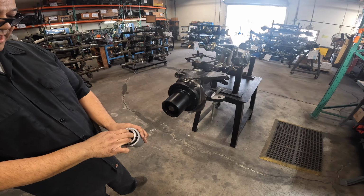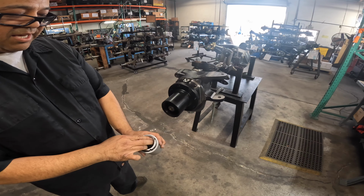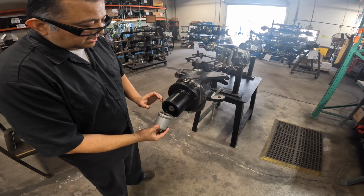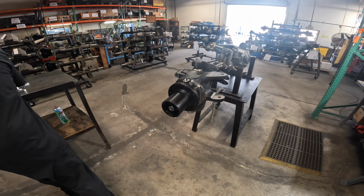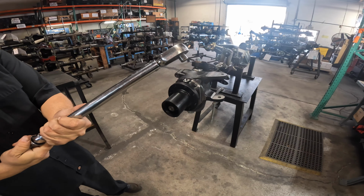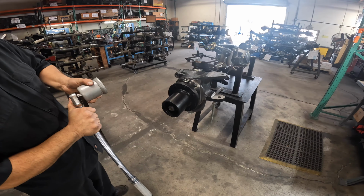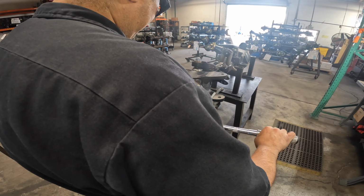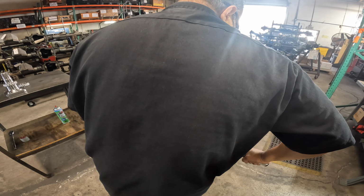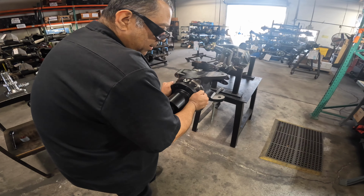Now we're gonna grab the second nut in 75 foot-pounds. So remember, this is not directional. There's no forward or backwards to the second one because there's not a pin on there. So a little bit of grease here, second nut, and we'll do our final torque. Let me set my torque wrench. So final torque should be 75 foot-pounds. After doing all that, we're just going to check our preload. Seems to feel good. No play in the hub.